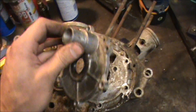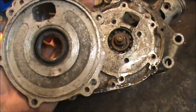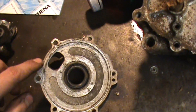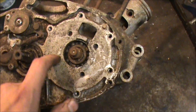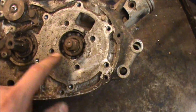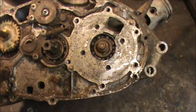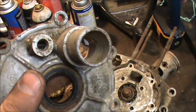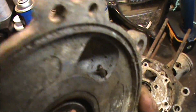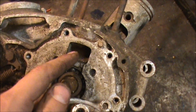So this comes right off like this. It has a little mark right here and a little mark right here to fit in the holes, so you make sure you're lined up. This should have a gasket along here and a little plate with a sprocket. This is called a rotary valve — it spins, allowing air and gas into the cylinder at a certain time. I'll show you how the oil injection squirts: you've got this little brass fitting hole, and then a little brass tube right there that squirts it right into here where your fuel and air is mixing.